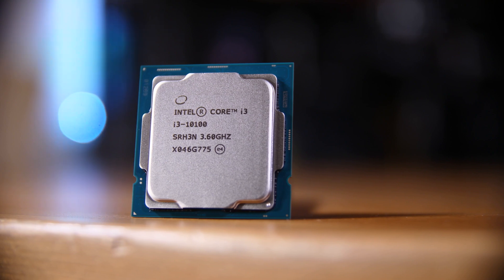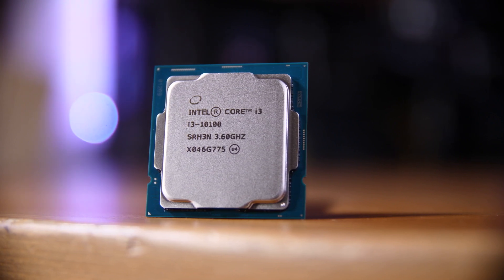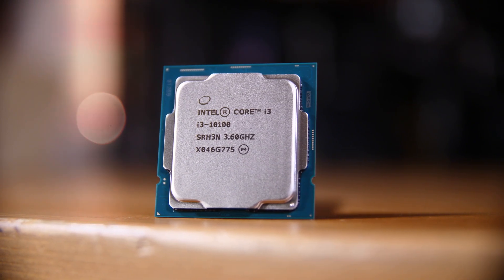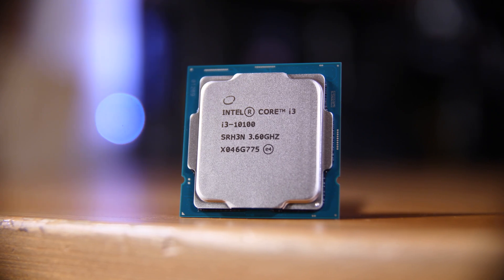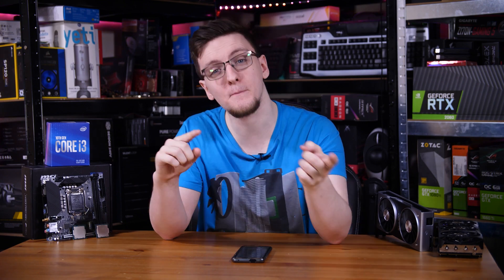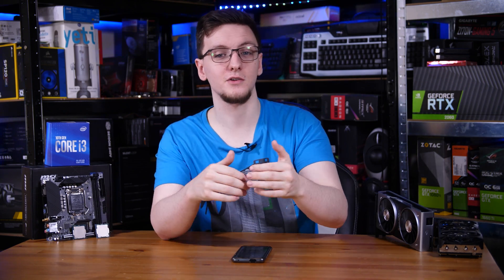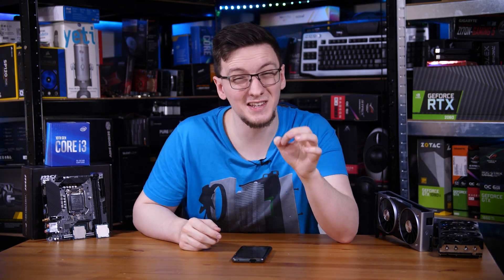The i3-10100 is about as low as I'd recommend you go for buying a new gaming CPU. Four cores is easily becoming, especially in more modern games, the bare minimum you'd want, and considering its value is pretty much the same price as the B460 or H410 motherboard you'd need for it, it's pretty hard to not recommend it. It does have some drawbacks, though — namely, for this generation, Intel was on the warpath to remove any and all features that weren't absolutely necessary, and then sell them back to you in K-SKU CPUs. One of those features was the ability to set your RAM to anything above their spec'd frequency, which for these i3s and i5s is just 2666MHz.